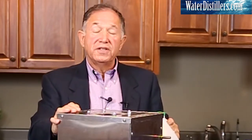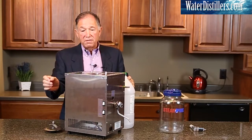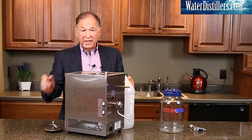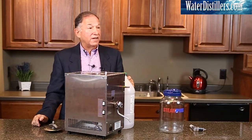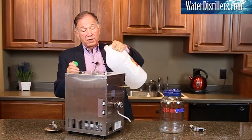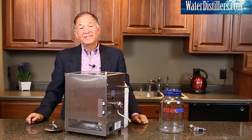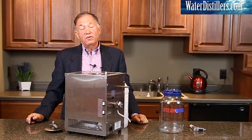Open it up and fill this up. Make sure it's unplugged, by the way. Make sure your distiller is off because you really don't want your distiller to be on while you're going through the descaling cycle — whether you're using chemicals or vinegar, it doesn't make any difference. Make sure it's off. In fact, I tell people to unplug it so someone doesn't turn it on inadvertently. You're going to pour your vinegar in there just above your heating element and let it sit there overnight.